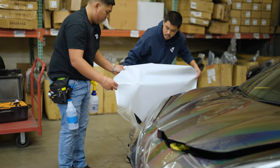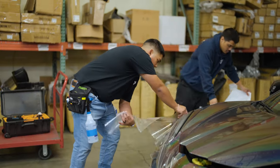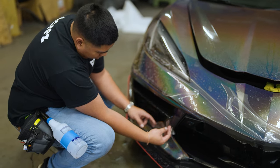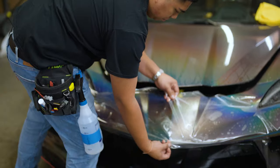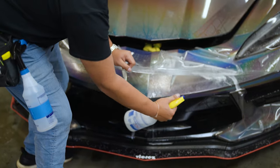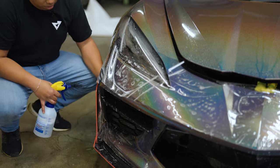You're going to peel the rest off dry. As you're pulling you want to spray your slip solution, and then you're going to go ahead and grab the remainder of your film and just lay it down. So because this is a pre-cut piece everything pretty much lines up. Where your front grill area is you're going to have your cutouts, everything sits up top, and then so your film doesn't set you're going to pick it up and spray some of your slip solution under the film. Make sure everything moves freely. You want to spray everything but your corners — keeping your corners dry is basically what's going to help you hold your bumper while you work from one side to the other.